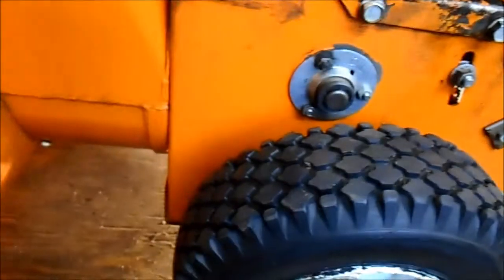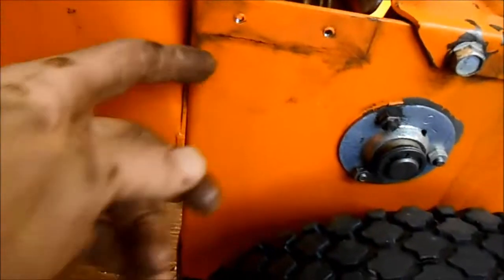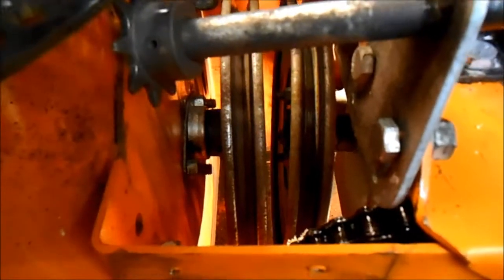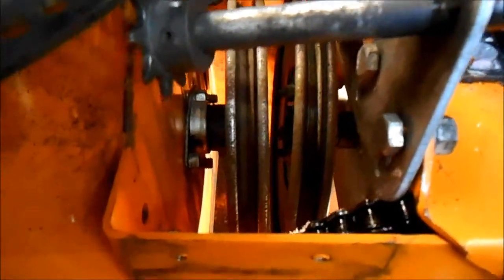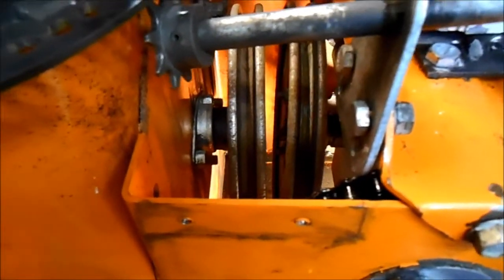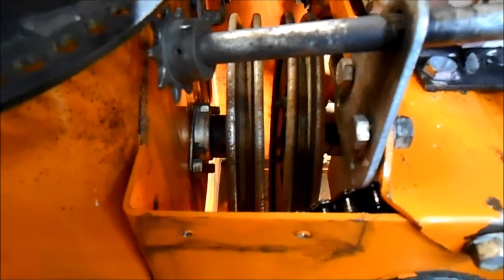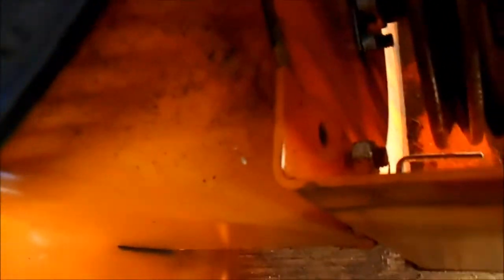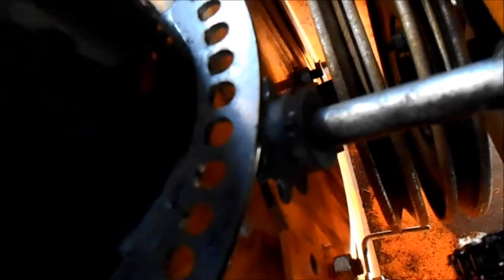We're going to take this snowblower off the stand, put it on the ground, and crack it in half, which is not a big deal. It's just 4 bolts on the housing. And I'm going to see if I can do a 6011 weld on that bushing. It's already broke, so we can't break it. Anyway, we'll have this baby apart in no time. I just have to take off 4 bolts just like that one there. 1, 2, 3 is off, and 4 down at the other side.